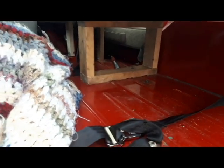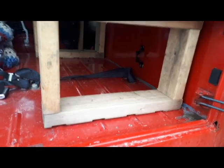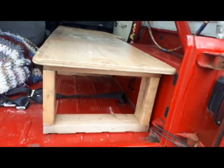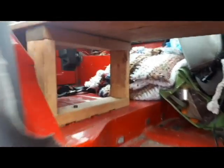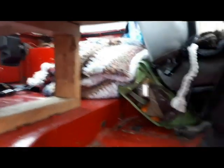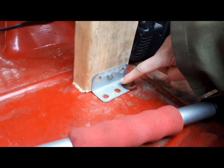When I took out my back seat, there were holes in the floor from where it was connected, so I just used one of those holes to screw down the bed. The back one is not bolted to the floor because the front two make it very sturdy — I'm trying to lift it and nothing's happening. Measuring the height of the front bed legs was the hardest part, since the bed floor is two different levels. Both back pieces are the same height, but the front ones were different.